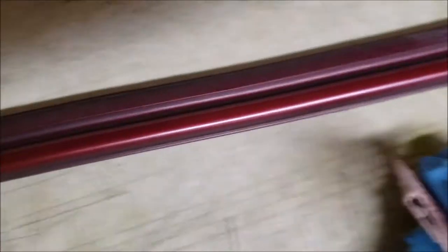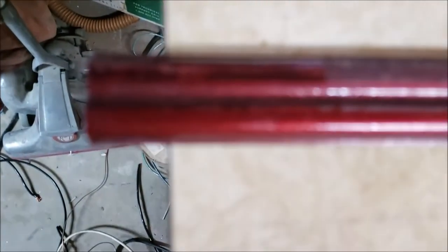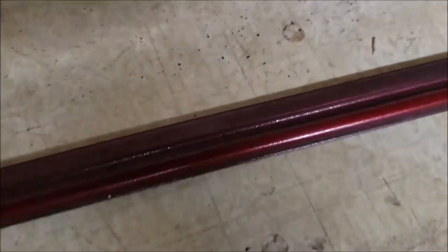Do that, and then you do the main part. Or if you have anything that's really divoted — like if it's got a pretty good door ding in it or something like that — you use that 100-grit sandpaper to get any really big spots out and smooth it back out. The color goes all the way through, so you really don't have to worry about the color, and you're going to respray it anyway. So these will look pretty good when we're done with it.